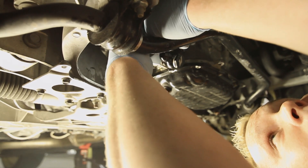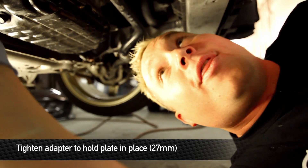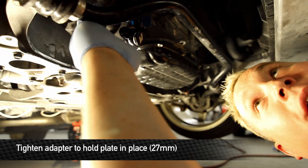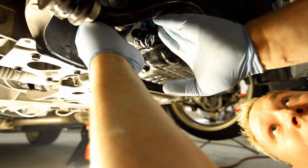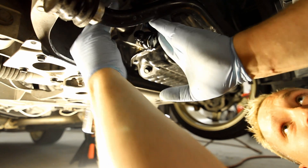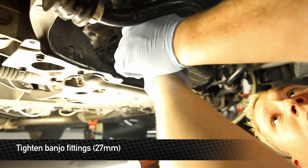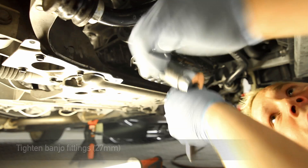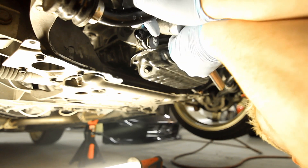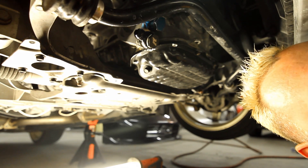The adapter goes directly in the center. Next step is to grab your 27mm socket and wrench down on that center nut — that's going to hold the whole sandwich plate assembly in place. At this time, you can tighten up the banjo nuts as well — they're the same size. Now we're just about ready to put the lines and mounts on.